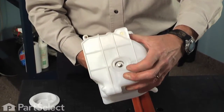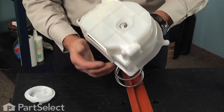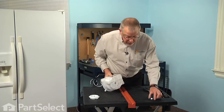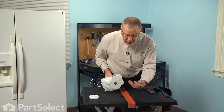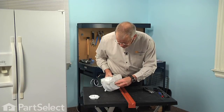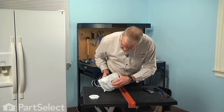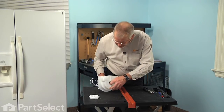And then just let the end of that auger shaft protrude through the end, and then we'll put that plastic nut and washer on. And then while we hold those pieces together, we'll next take our large flat washer, set it over that shaft, and then we'll take the nylon nut with the E-ring, and keeping in mind it is a left-hand thread, so we're going to turn it counterclockwise to install it. We'll need to make sure that it goes inside of that thrust washer as well as the opening in the housing.